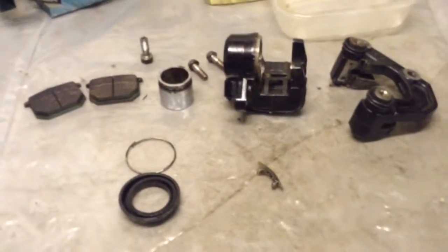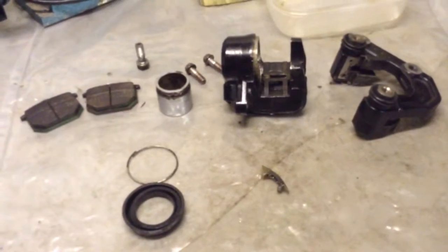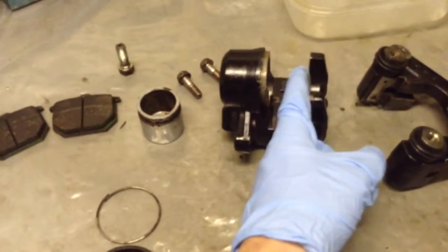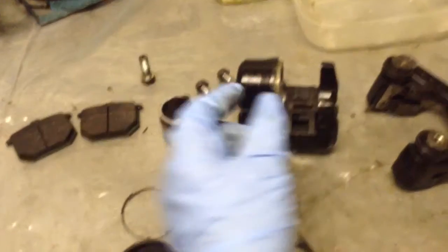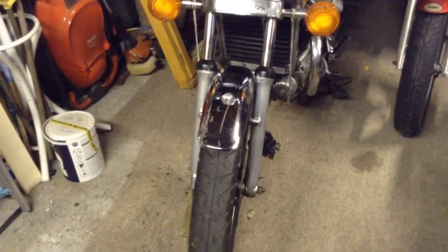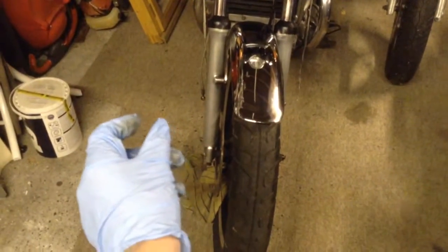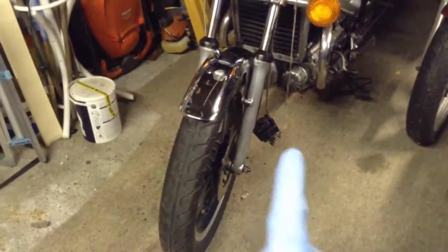I don't think this one is the one that's causing me the problems. Because when I wheeled the bike in, the brakes locked up and I had to wrestle them both off. But when I got the calipers off the discs, you've got a gap between the pads on either side. If you pump the brakes, the piston will operate and push the pads together. On this caliper, both calipers should operate at exactly the same time. But when I pumped the brakes with the calipers hanging free, the pads on the right-hand side closed until they touched. Then the left-hand side operated. They should really operate at the same time. So that tells me that one is more sticky than that one.